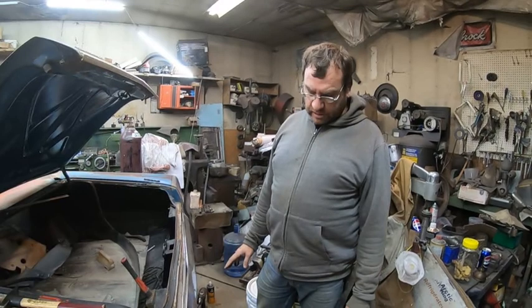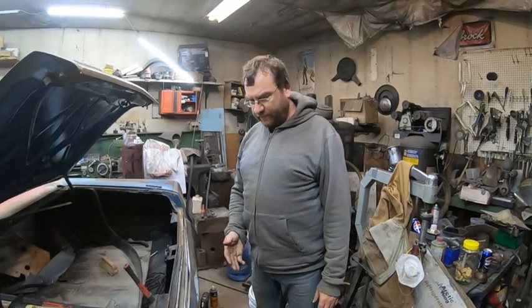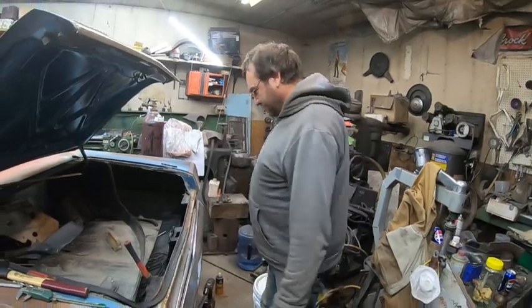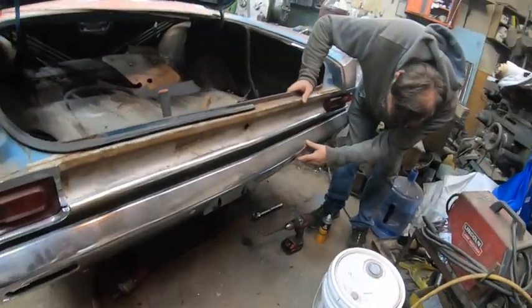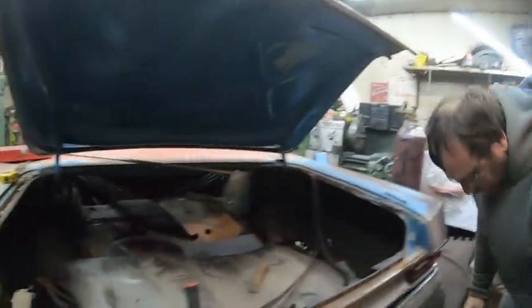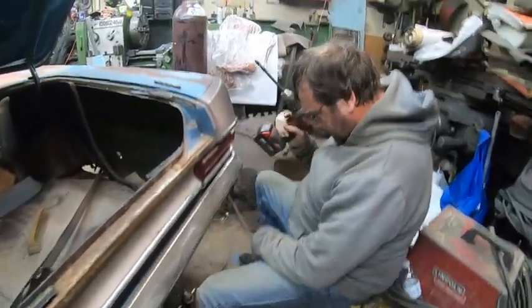We'll drill them, and it was either drilling that or cut the bumper brackets in half and weld it back together. So this seems to be the more safe way. Yeah, it costs a bit more for bumper bolts, but we already did one. We drilled a pilot hole and then a bigger one. I found center and marked the center, and he drilled it, and then he step drilled it, with three different size bits. So, yeah, taking your time.